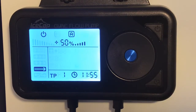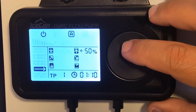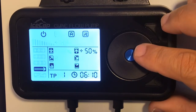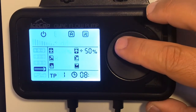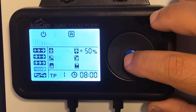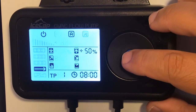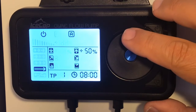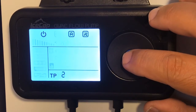Next we're going to set the timer. Press the bottom right button and you'll have the TP button flashing. Press the blue button to switch the hours, then rotate the dial clockwise or counterclockwise to set the hours. The minutes go by five minutes at a time and it's in military mode. Once set, press it again. Press it a third time and it should go back to TP. Turn it to TP2 and press the blue button again, then rotate the dial and the hours will come up.